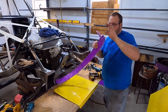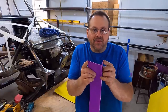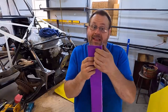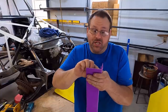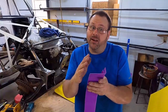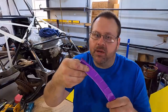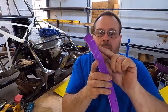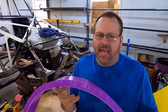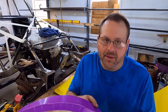All right, y'all, take a look. I cut it. It's actually about 4 3/8 of an inch total here. The reason being is I made sure I had 1 inch of flange here, and then after I got it bent, I measured 3 inches across to make sure the fan shroud would be out as far as I expected. Then I made 1 inch rips all the way around, and I would have done the same with aluminum. I thought I might could take a heat gun and stretch it to make this work without having to cut it. Not gonna happen, which is fine.